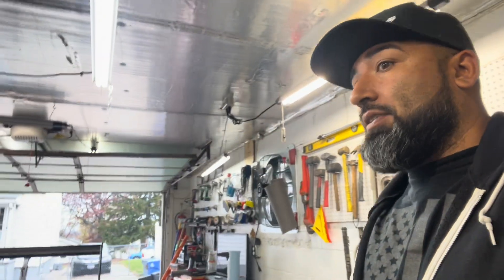There are some imperfections. Every time I've made something carbon I've been trying a different technique, and it seems like I'm just getting worse. The roof turned out the best, the hood not too bad, this is terrible. But for the amount of money I have in this, I'm not going to start over. So we're just going to finish it. I should have never cut it until the second layer of epoxy was on, but this is my third carbon project — you live and you learn. I went over it and wiped the whole thing with wax and grease remover, and right now I'm just going to mix up some epoxy and put a heavy layer on it.